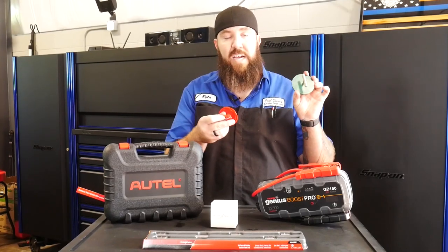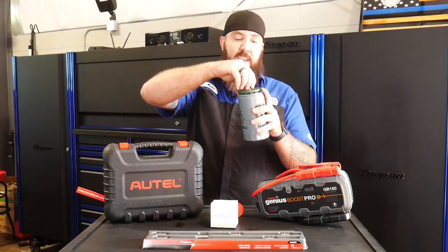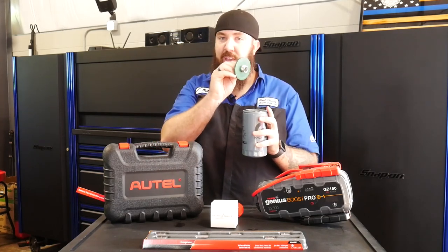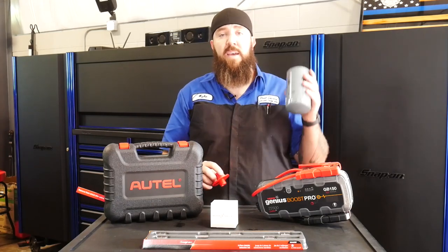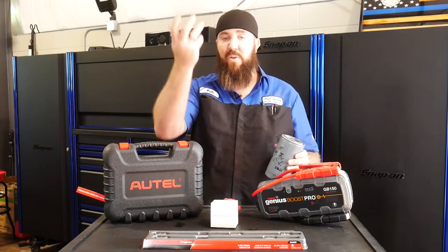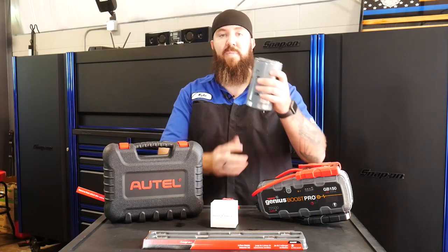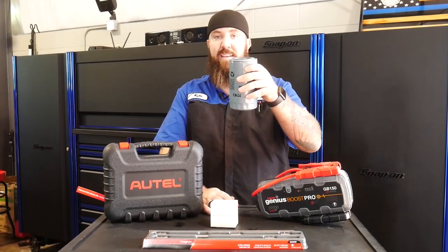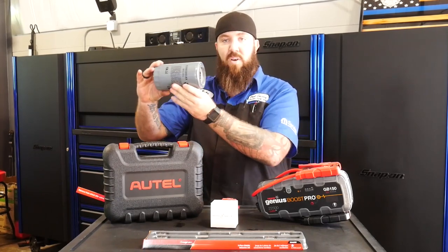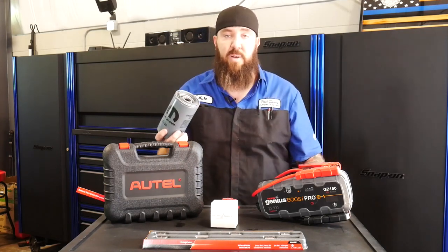The Lyle is a two-piece design, and once you get it going onto the oil filter, the handle can actually spin, so if you don't get it in there right, it won't seal correctly — one of my biggest pet peeves. Now, for those who don't know what I'm talking about: on 2014 and newer Cummins, the oil filter has to come out through the fender liner area. You unscrew it by hand and realize it doesn't come out vertically — you have to tip it over and pull it out on its side, which dumps oil absolutely everywhere.